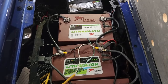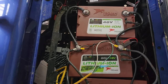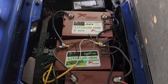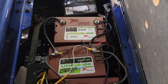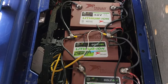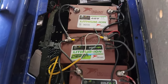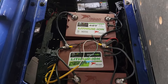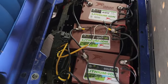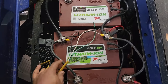You do not want to be severely draining a lithium battery — that is not something they like. Lithium batteries are really happy staying above 50%. Some new Samsung phones have a feature to only charge to 80% because trying to charge above that reduces life. Draining below 40% or 50% is still not great. Keeping these batteries charged as much as possible will increase your battery life.